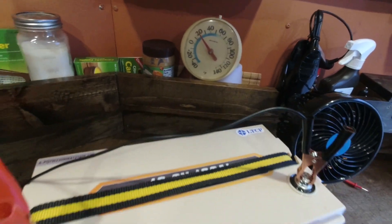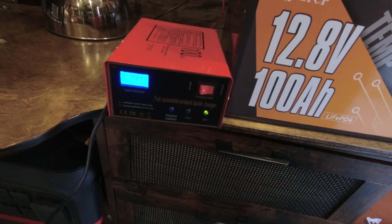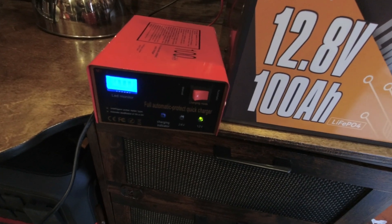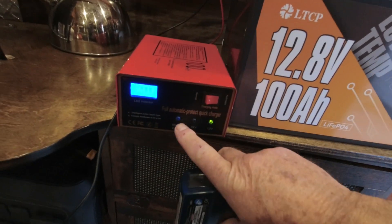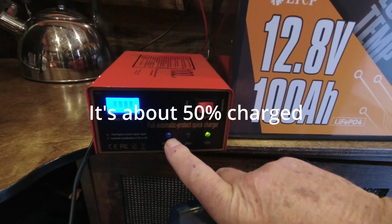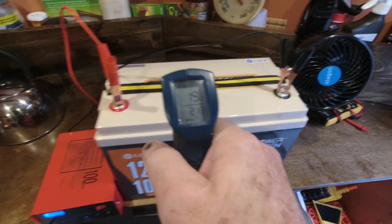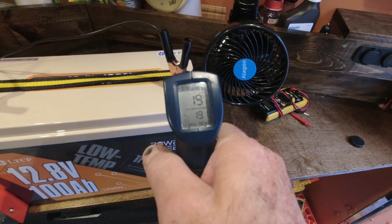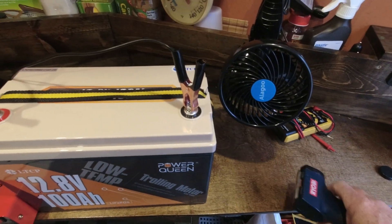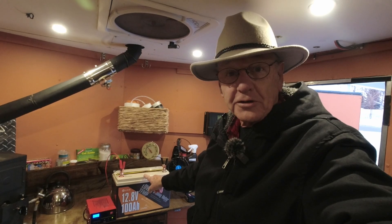Down to 20°F there, and you can see the battery has finally stopped accepting a charge. The light's not blinking, and over here it shows a full charge — but it's not taking a charge. Temperature at the post is 19°F. That actually took a lot of time; it didn't go as I expected because it took so long for the core of the battery to drop to 32°F.